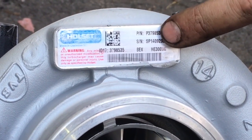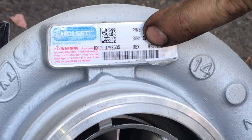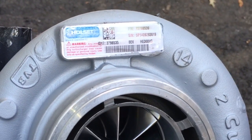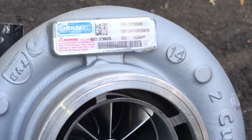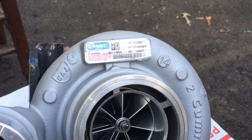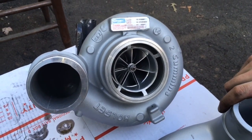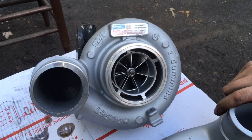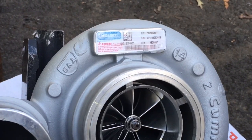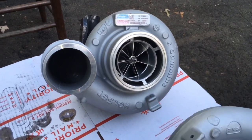In this video, Ian is going to show you the difference between the 2008 to 2013 and the 2013 to present (2016) Dodge Ram Cummins 6.7 turbo diesel turbo differences. The earlier model 2008 to 2013 usually had an HE351VE turbo, which is the current kit that we have and sell, and a lot of the parts from that kit do work in the HE300VG.